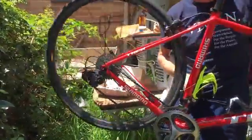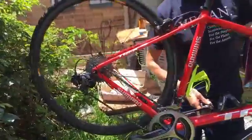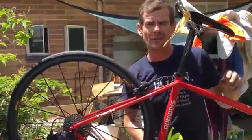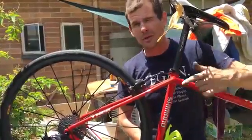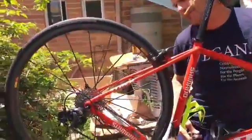Let's go through the gears. A lot of people say that if you've got a GS derailleur it'll only work with 32, that the SS short cage derailleur won't work with 32 — or it might work but the shifting's not good. Well, shifting's good. I've got 19,000 km out of a Dura-Ace chain, 11-speed, with a 32 cassette and SS derailleur. So if anyone says it doesn't shift, check this out — this is precision.